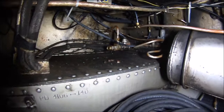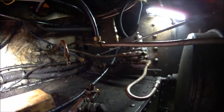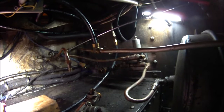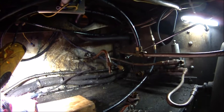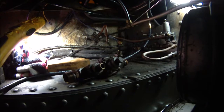That's the line from the air tank right there. This is the line to the parking brake, and this is the line to the auxiliary system. Over there is the low pressure switch for the air buzzer, the low air warning light. So we're going to take this apart, clean it up, and see what's going on inside. I'm probably going to just take the guts out of the thing, because I'm not sure what's causing the blockage.